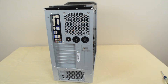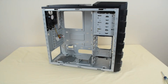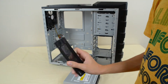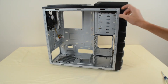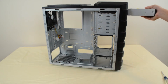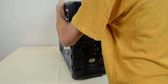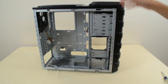Now if you're installing a DVD drive — which I highly recommend — we're going to put that in now so we don't have to mess with anything later. Here's my drive; it's going to go right up top in the front. Look at your manual to see how the face plates come off. Mine you just reach inside and squeeze the little tabs. Take your drive — mine has an unlock and lock quick-release — set it to the unlock position, slide the drive in until it's lined up with the rest of the face plate, then switch it back to lock. Our drive is now installed.